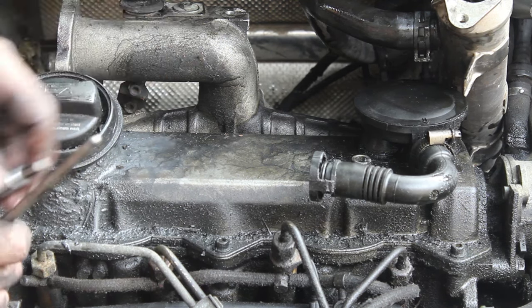For this step, we are going to use this highly specialized coat hanger to make a tool to clean the rest of the gunk out of the intake manifold. So we're going to take and straighten the end of it out, and that's what's going to go in our drill. And we are simply going to pull it together like that, twist it up a few times, and that simply is what we are going to run in the intake runners to clean them out. I like coat hangers because they have a lot of good uses, and this is nice and flexible, and it doesn't cost us anything.